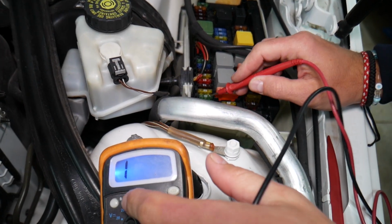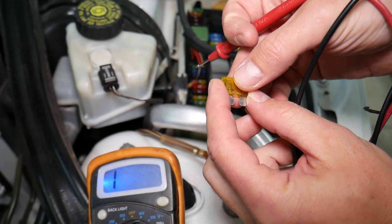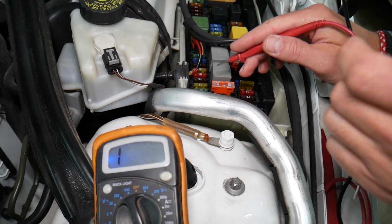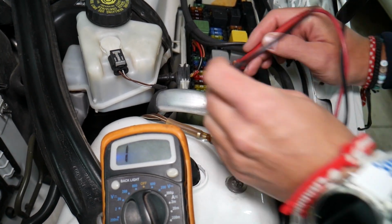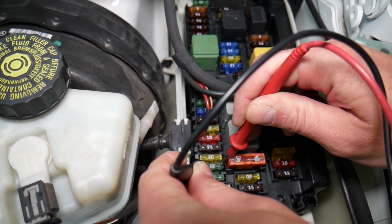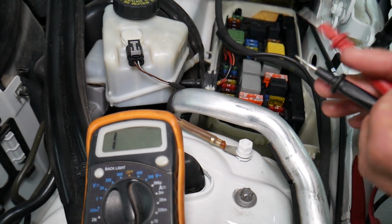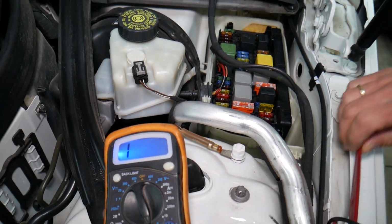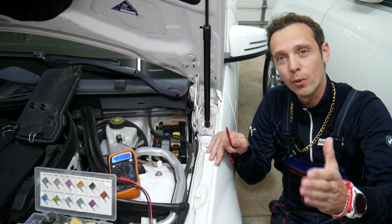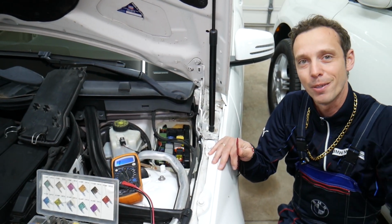Now, some fuses are super hard to see if they're burnt or not. Some of them will be really easily accessible, you can clearly see them, but there will be fuses that are not see-through, fuses that may look like they're not burned, but they're actually burned. And often you can even test these fuses without even removing them. But it's very important to know how to test different fuses and relays, and if you want to see how to do that, we're going to put a link to a video in the description below, how to test a fuse, how to test a relay. Always check that. I want to emphasize that enough because it could be a really simple fix.